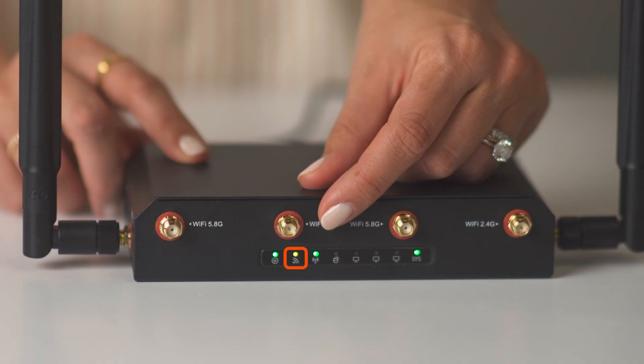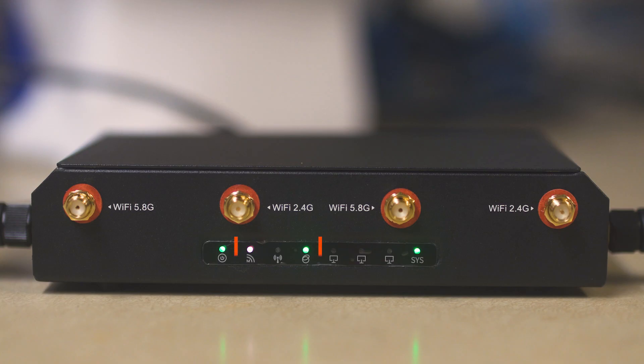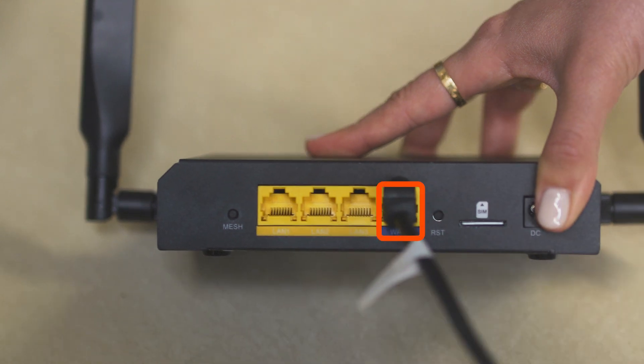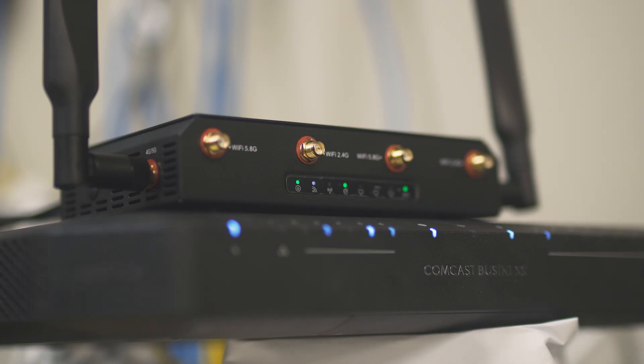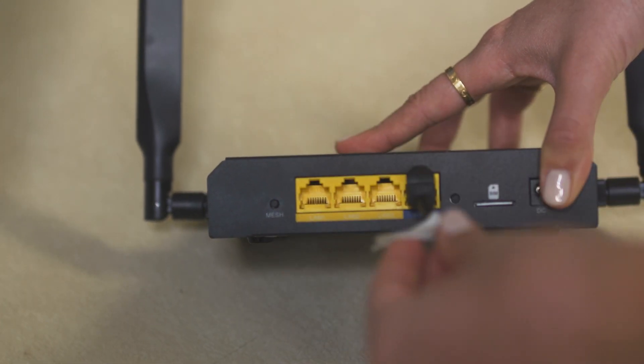If the second light is yellow or red, let's look at the connection between your internet modem and your Toast router. Start by making sure your internet modem is powered on. If not, power it on and wait 90 seconds to ensure the modem has started sending internet to your Toast router. Next, confirm the internet modem is connected to the WAN1 port on your Toast router. This port is reserved to ensure internet is flowing from your internet modem to your Toast router. You should see the lights on the internet modem and the Toast router light up.